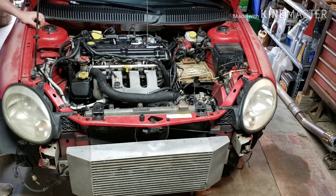In order to perform this test, the first thing you're going to have to do is remove the spark plugs and your spark plug wires out of each one of the wells.